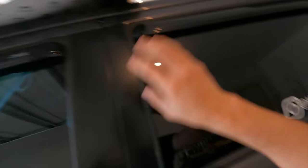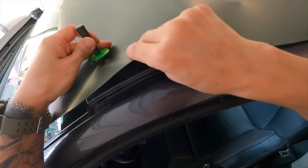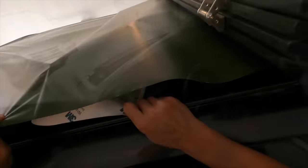Car wrapping vinyl comes in sheets that are 5 feet in height and rolls as long as 75 feet. For this project, I picked up a total of 5 feet by 75 feet. Now, I used the wrap magnets to hold the vinyl in place while I positioned it on the truck. Then from one corner, I peeled the vinyl backing paper and started the long fun process of squeegeeing the vinyl and filling up my swear jar.